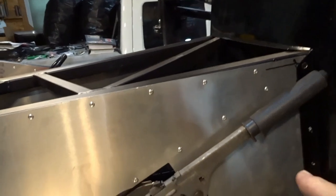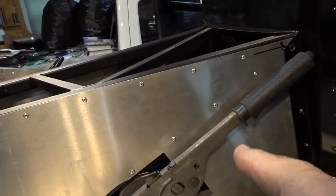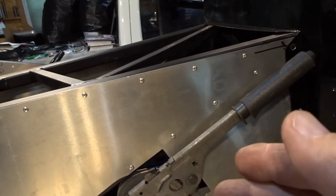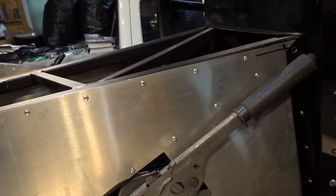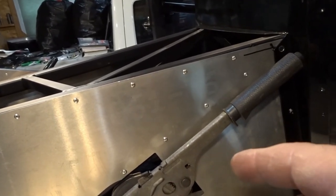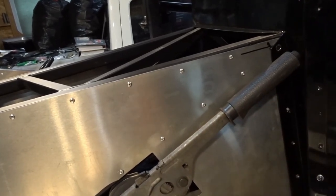So the brake handle going the donor route works so much better. If you're using the Factory 5 supplied rear brake calipers, which are Mustang calipers anyway, it's plug and play. When you start mixing all these different parts, they're using SN95 rear calipers with Fox body cables, and then they're using their handle. And then it's got to run under the frame.